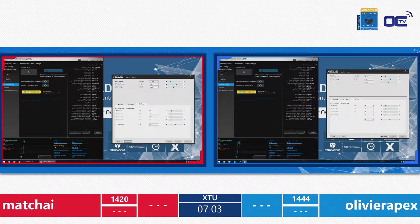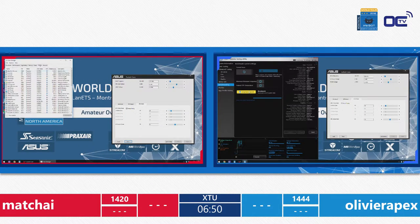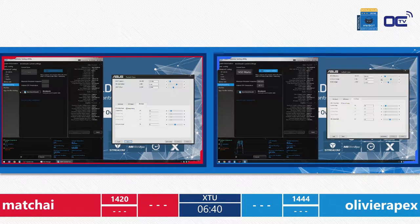In fact, what we want to do here, Onishan 0222, is just get some extra performance. Intel has these K series CPUs, AMD has their FX CPUs, and they have a free unlocked multiplier. You can increase the multiplier via software tools in Windows, or if you're a little bit more expert, you can change the multiplier in the BIOS. What does it generate? Today we see 6700K i7 CPUs from Intel. They run stock at 4000 megahertz, and we see the guys clocking them up to 4700 megahertz. Maybe not ideal for daily usage, but 4,500 megahertz should be easily doable on all CPUs, which means you get 500 megahertz for free.